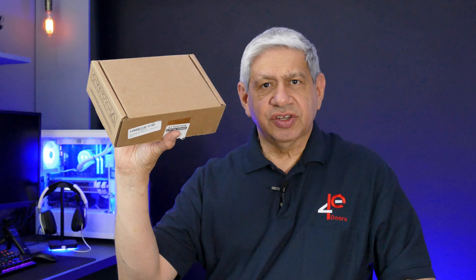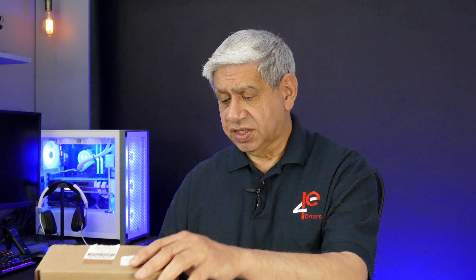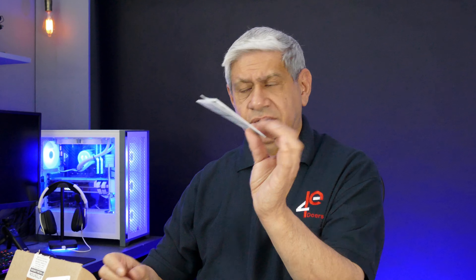Now I'll start off with the one thing that is not related to the camera, and that is a new hard drive. This is a six terabyte surveillance hard drive that I ordered, to replace the surveillance hard drive that's in my existing security system, which has been getting some errors. It rebooted a couple of times as a result of it too. So I'll change the drive out because the history of the errors is quite high on it. This particular one is a Seagate surveillance drive.